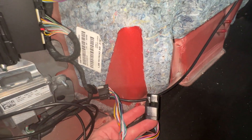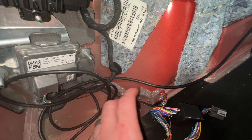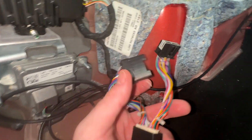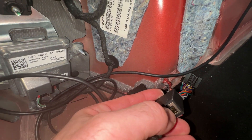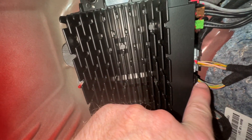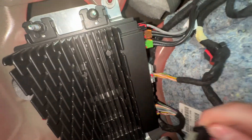What you get is this — a Ford Q4 connector. This is a version 1 which has a 3D printed socket on it. The version 3s that they're shipping these days actually have a gray injection molded plastic, but this end looks the same. This box has a Cat 5 cable on it, whereas the newer box just has a little 4-pin connector, but they do the exact same thing and install the exact same way. You need to get the black CAN bus cable, not the gray one — make sure you get the black one — and unplug it from your IPMA.